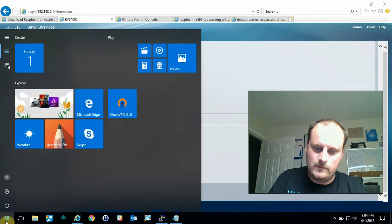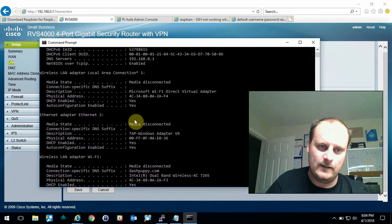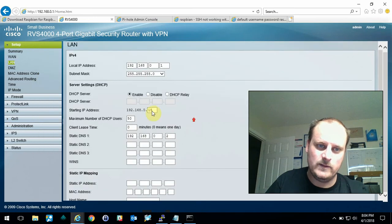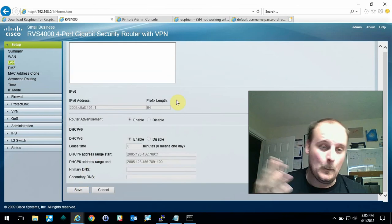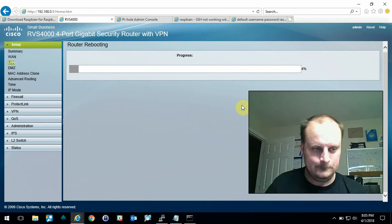Watch this. So command, and we go ipconfig /all. So right now this is handing out 0.1 as our DNS, right? If we push save on this, it's going to change it and say, no, you're not going to use 1, you're going to use 2. And if we go save, this thing takes about 30-40 seconds to reboot because it's so old.